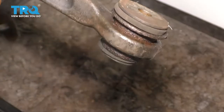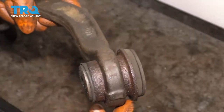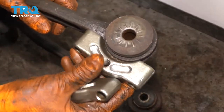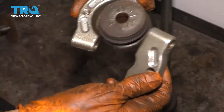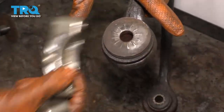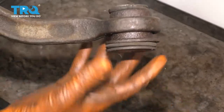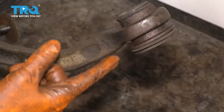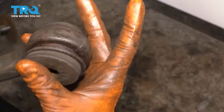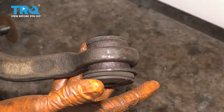To replace the bushings, we have to press the bushing out — it only comes out one way due to the lip. Ideally you'd use a seal puller to grab the lip and a ball joint cup to press it through, but my tool is broken. So instead, I'm going to cut the bushing to gain access to the control arm face, so I can place a ball joint cup on it and press the rest of the bushing up and through.